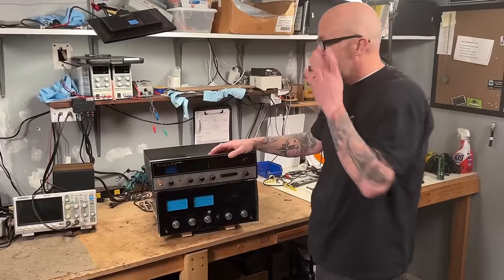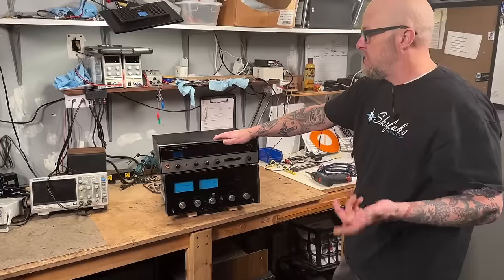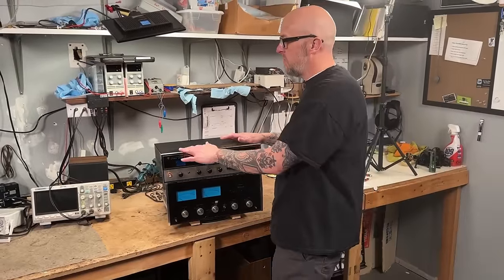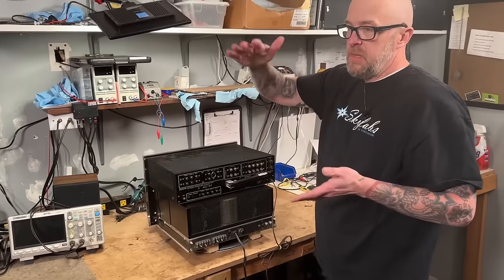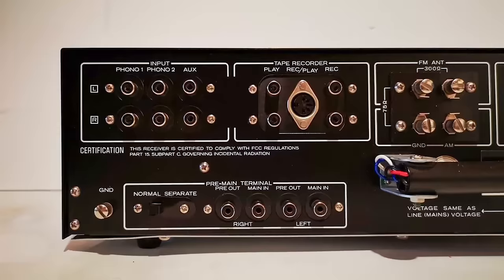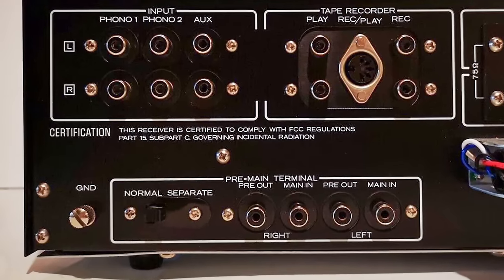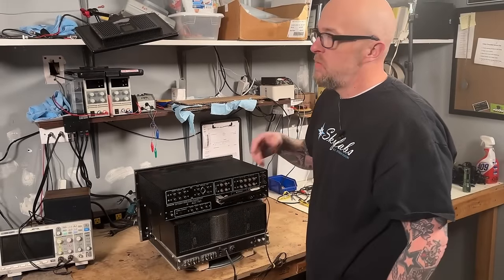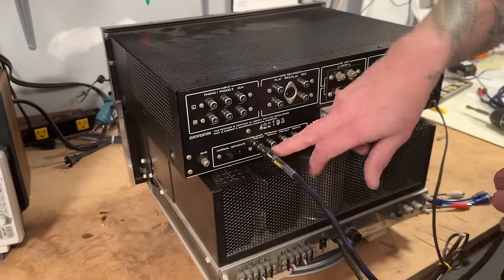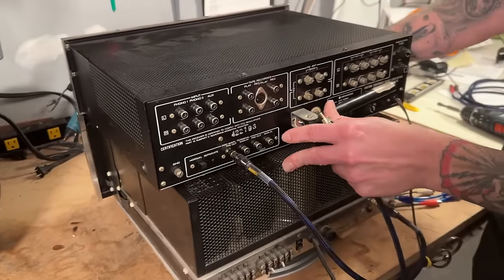From the beginning of the video — we do get quite a few people come in saying they want to keep their receiver but add more power, and they don't know how. You do have to have one specific feature in the receiver or integrated amplifier to make this work. A lot of people think you can just put an amplifier on a receiver, but that's like trying to add an engine to an engine — you can't do it. You need pre-out and main-in to do it correctly. When looking for a receiver that you plan to add an amplifier to, pre-out is something you definitely want to have. You go out the pre-out and into the amplifier.